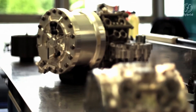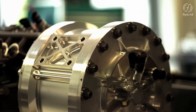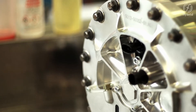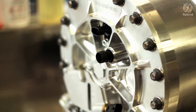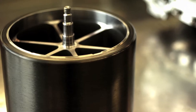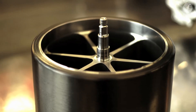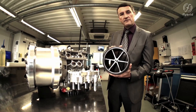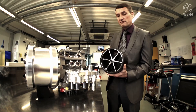This is the hybrid system fitted to the Jaguar. On this end we have a containment housing inside which the flywheel sits. This housing is evacuated — pumped down to a very low pressure — to reduce the parasitic losses associated with spinning the flywheel at very high speed. The flywheel itself is a five kilogram part, about 12 pounds in imperial units, made of carbon fibre and steel. The surface of the flywheel will be doing about Mach 2 when rotating at full speed, which is why the vacuum is really important.